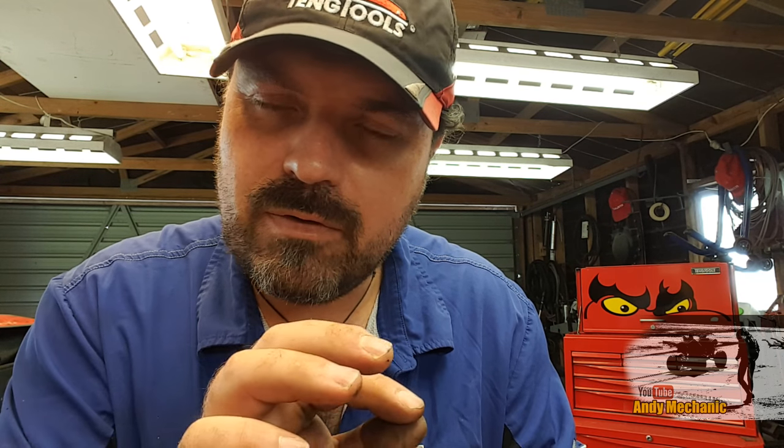The reason I'm going to leave that out is I want you to see how the ECU has control of the shaft, the valve, once the engine's warm, because that's what it's all about. Once this has turned that full 90 degrees over to this side, it has much less torque effect on that valve, and essentially the valve closes. Not all the way, but most of the way, so the engine revs come down. But every now and again, the ECU is going to want to bring those revs up.